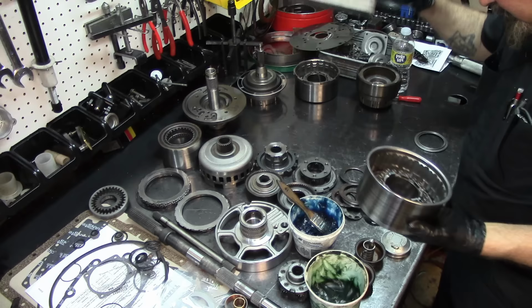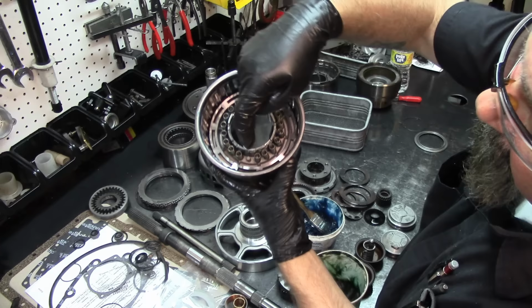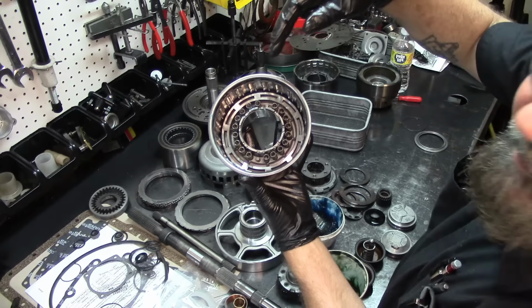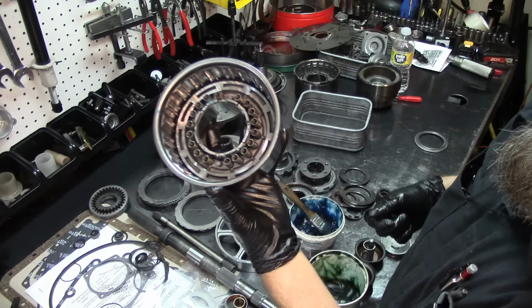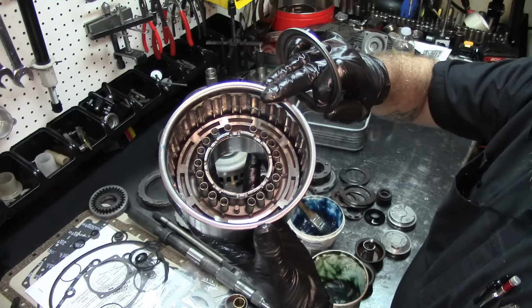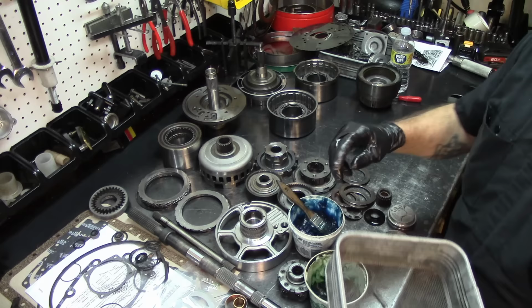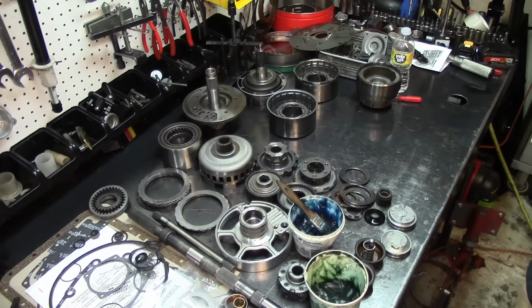And this one is missing one spring. So whenever you have one spring missing like that, go to the opposite side and just remove the one directly across it. You want to make sure that it's equal. Just count the springs. 1, 2, 3, 4, 5, 6, 7, 8, 9. So you got 9 on each side, and you got one left over, which is no big deal. That's what a lot of builders do to this drum and to the forward drum as well. But those are full, and this one's missing one. And that takes care of that problem, and you do the old school builder's mod, or whatever you want to call that thing.